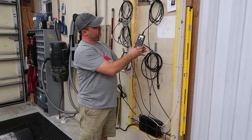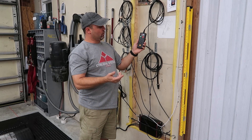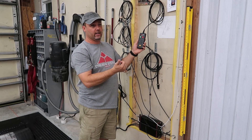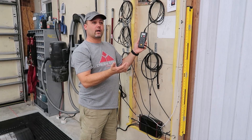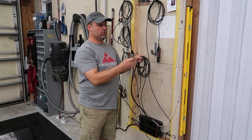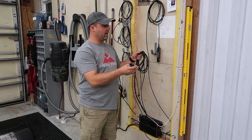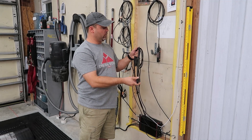This one is what they call the pendant. This is what you'd have in the car as you're making a pull. You can use these buttons to control the dyno - tell it you want to make a hit, apply the electronic brake, bring the drum to a stop. This one here is a boost or vacuum sensor, so I can use the dyno's computer to log boost, vacuum, or anything in between.